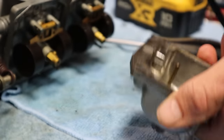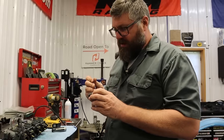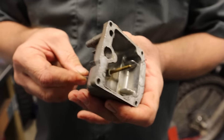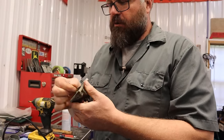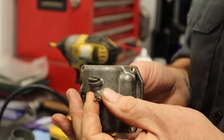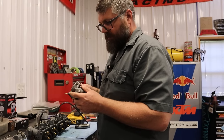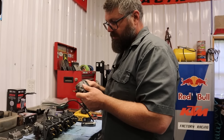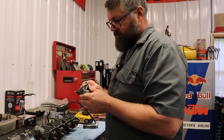Clean out the vents or the drain. At least if I do this it'll drain out of the overflow instead of out of every hole in the carburetor. How badly clogged were those? Well this is just an overflow — so if the float bowl fills up too high it runs out. Cleaning these out means it would leak less because there's less pressure, since it can go through the overflow. So inevitably when you put them back together and clear the overflow, it actually leaks even harder at first.